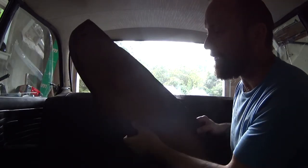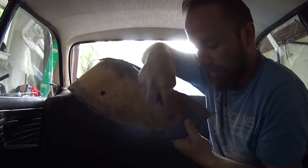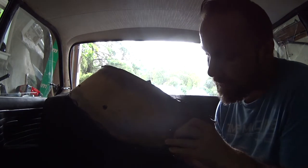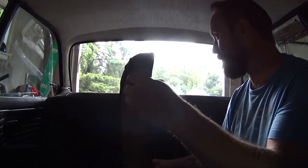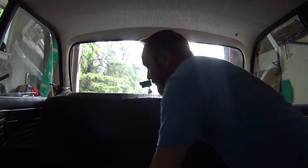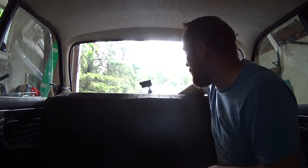If you look, my original parcel shelf cover already has a provision. Mine's pretty nasty, so I'll probably make a new one. But right here, there's already a hole there. So what I'm going to do is just poke this through the vinyl and drive the threaded nut through there. To find these fasteners, you've got to get a lot of goo out — up inside the threaded hole there's some SikaFlex or something. They probably filled it from the factory, or in the 50 years the car existed. You've got to dig that out and you're good to go. Then I'll just slip the parcel shelf cover back up and start throwing the brackets on.